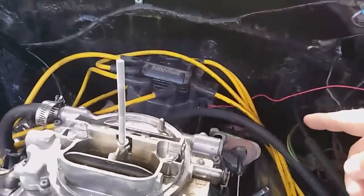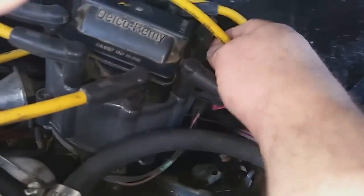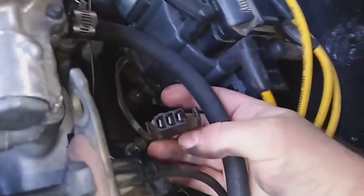Then you pull three wires. There is one wire that has two side clips — you can see my finger on here — and then there's one on the other side. These distributors on the GM are not easy to get to. On the other side they're like a thing you typically just pull your finger outward, even your fingernail, just a tiny bit and it slides out. It has these little things on the side that kind of move in and out like that.